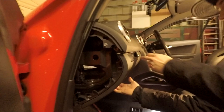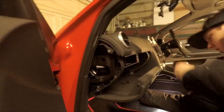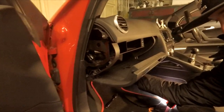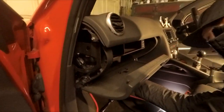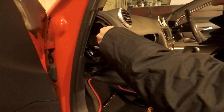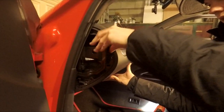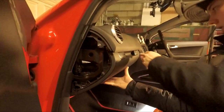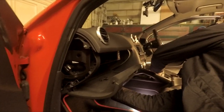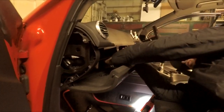Open up the glove box and try your best to get one of the screws in while you're holding the glove box up. I'm going to go for the side one so that I can hold the left side up. You just need a couple of threads just to hold it up — the left side is already held up now. Then grab the glove box again and get another one of the top screws in.